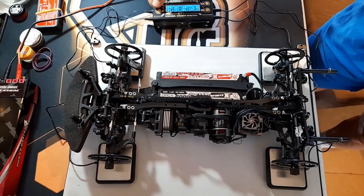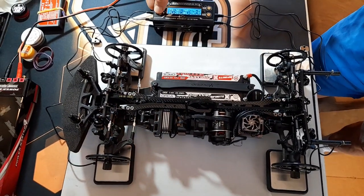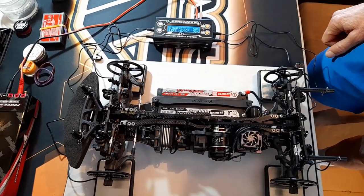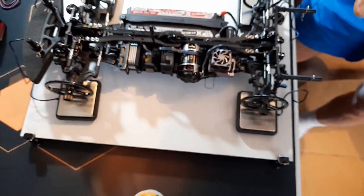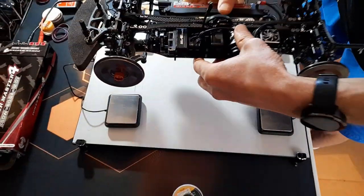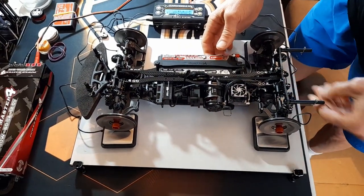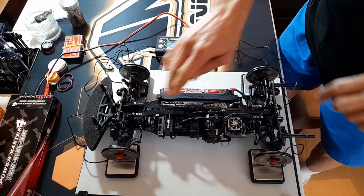That's good. I'm not sure what to do with that corner being out that little bit, but when you average it out — 50/50 front to rear, 50/50 left and right — you'd say that's pretty good. All right, that's this car on standard rear uprights. My other car has the setup wheels on but still has the springs on the car, and it's got the RTC on it. So it'd be interesting to have a look at what this one is — front to rear, left to right as well. Should be a little bit heavier on the rear I guess; the springs might confuse things a little, but we'll see what it says.